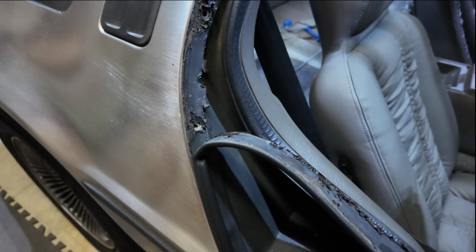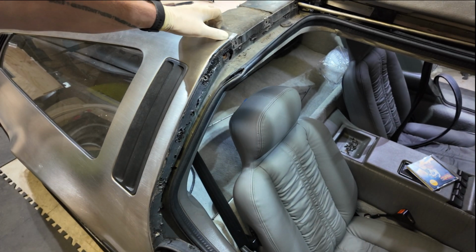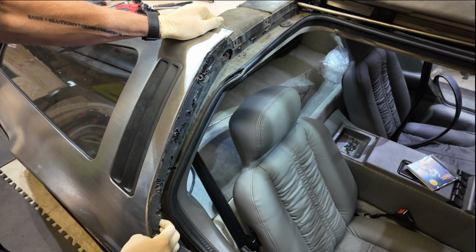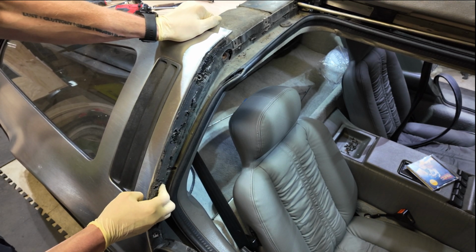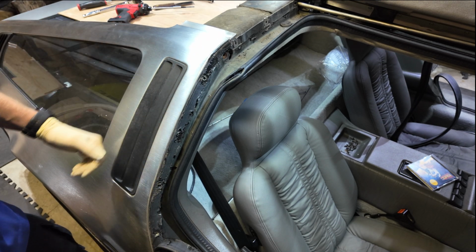Make sure you get that last one. It makes it possible to get this rear panel to come loose enough. Otherwise you could possibly crinkle it. See where my right hand is down there? There's actually a cut in the body panel that will flex like crazy if that bottom screw isn't removed, and potentially crease.